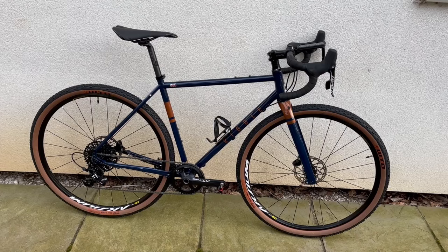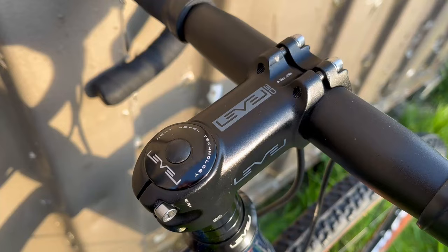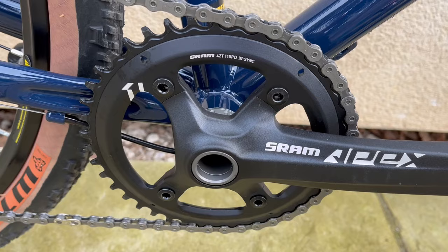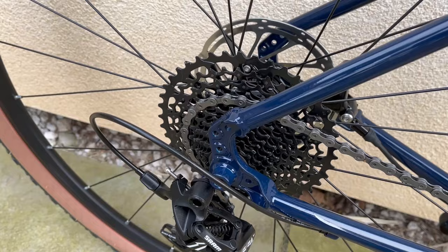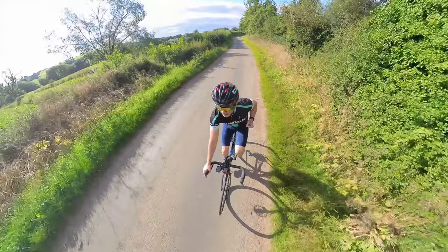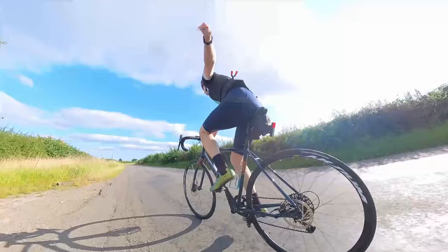The specs. We've already mentioned that I bought the steel frame CGR. I went for the bottom of the range version in terms of specs and did very little tweaking. I may have swapped out the standard flared handlebars for narrowish road ones and opted for a slightly shorter stem, but that's about it. The bike has a SRAM Apex 1x groupset, with a single 42-tooth chainring at the front and an 11-speed 11-42 tooth cassette at the back. I'm a spinner not a grinder, a lover not a fighter, but the easiest gear has a 1-to-1 ratio, which is actually lower than the 'oh my god there are no more gears' gear on my road bike. At the upper reaches I am able to spin out, so if this were my only bike I'd probably go for one with a 2x chainset option — but as it isn't, I didn't.